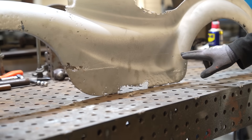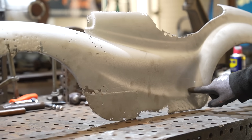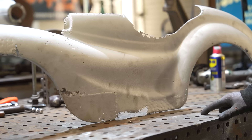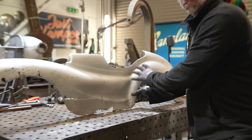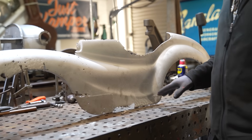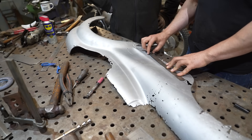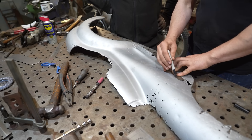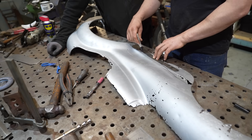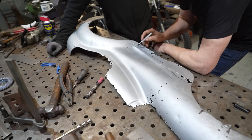We've got a swage line here so we've got to be careful of this. That's solid up there — nice to keep as much good metal as we can. I think if we start, we've got quite a lot of reference and we've got the other blue car to template off of. Transfer those to steel, cut that out, shape it and hammer it around. Hopefully by the end of this episode we'll have that piece welded in. So I'm going to go there, then across to there. You can't go this low — you're going to have to go on that edge.